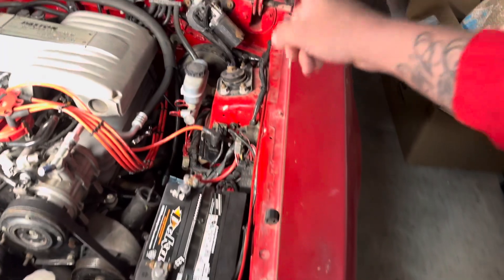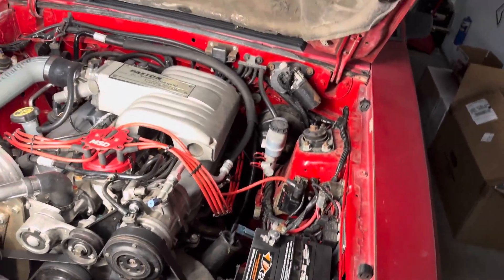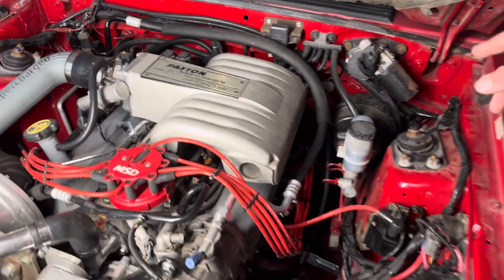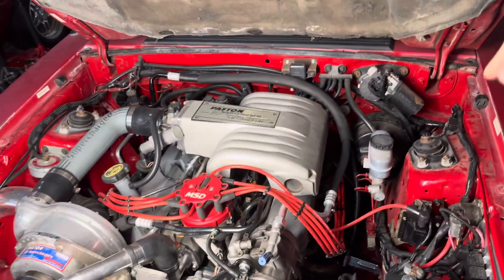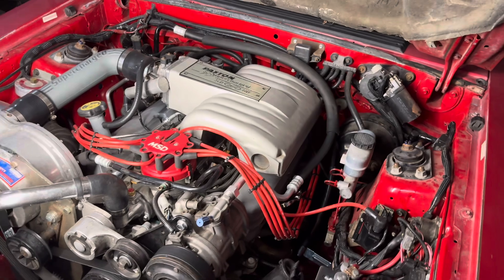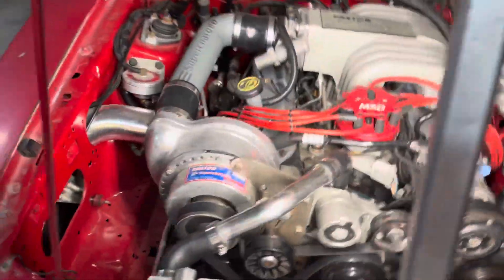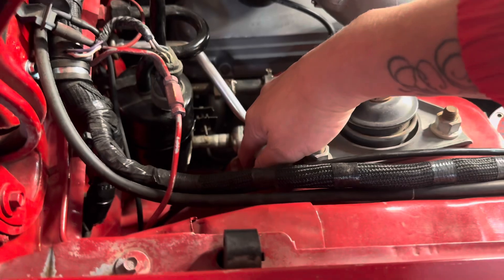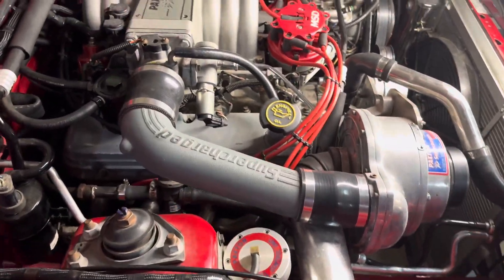You can use your stock four-cylinder brake booster and master cylinder — they're different for the V8, but not 100% necessary to swap out. If you have the motor out though, do it — don't wait. The vacuum lines are different on the four-cylinder; you can keep them but you'll be able to tell it was a four-cylinder. Clutch cable, obviously, if you're going five-speed. For the speedometer cable, I always run it without cruise control because the cruise control ones with the VSS sensor will leak. If you're in a smog-compliant state, you'll need the EGR solenoids and all the vacuum lines that connect to the smog pump canister.